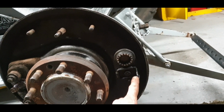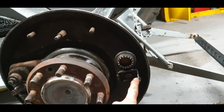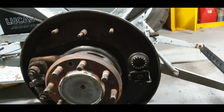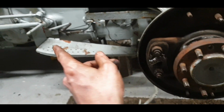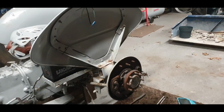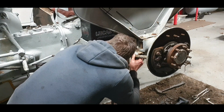Now I think the other side actually has both sides gone. Both them little things gone. To be honest with you, I thought it was a newer aftermarket part that I hadn't seen before, and I didn't actually think it needed replacing. It was only that triangular bit, but now looking at this side, yeah, it needs to be replaced. So they're going to go in. I'm happy with the shim, and so I can just go ahead here now and put in the brake rod, hitch up the narrow rod, this rod here. I can do that, but I just said I'd mention that, and I'm not happy with the other side. I think what happened was when I adjusted the brakes, it just couldn't centralize itself because that has gone. So we'll see if it's any better when that comes. I would like it to be better. I'm not particularly happy with it.